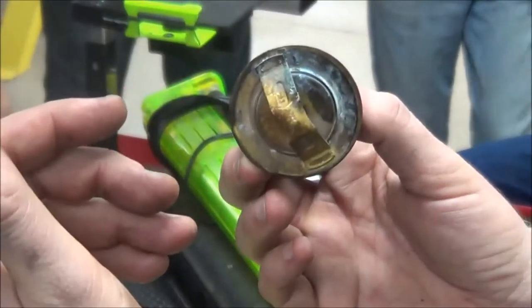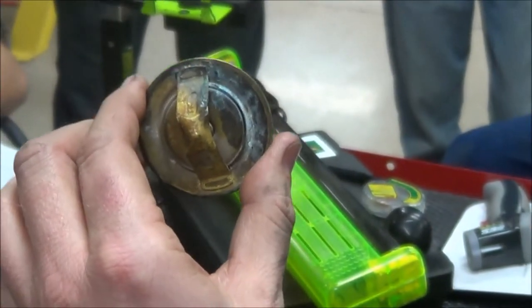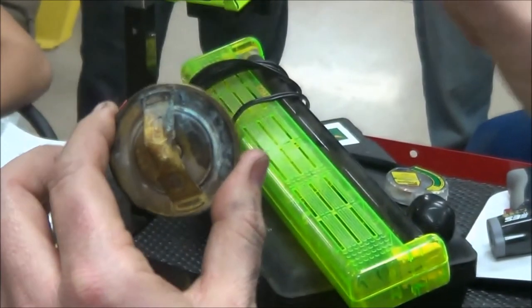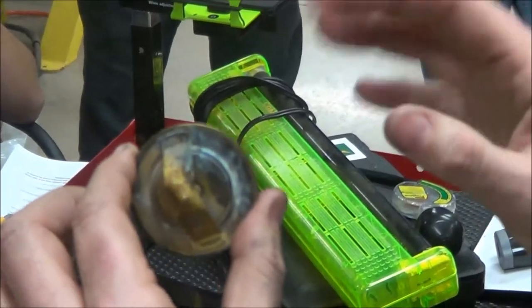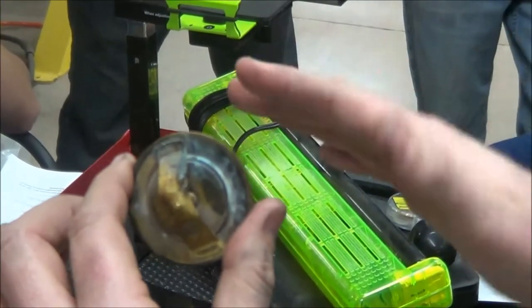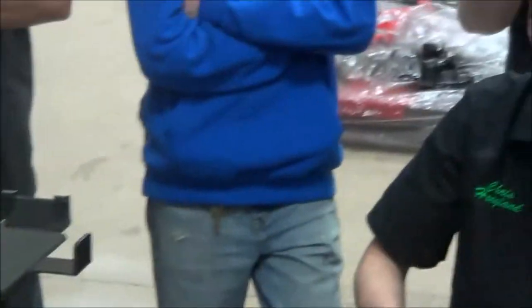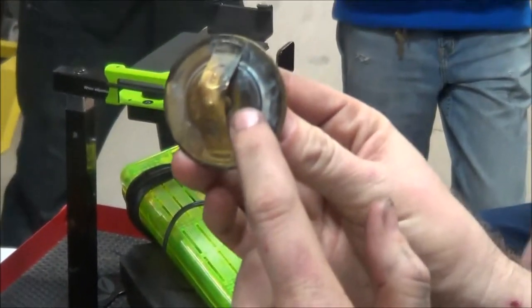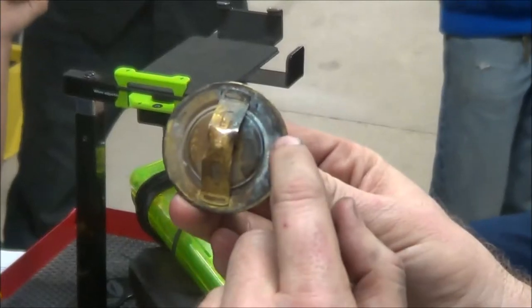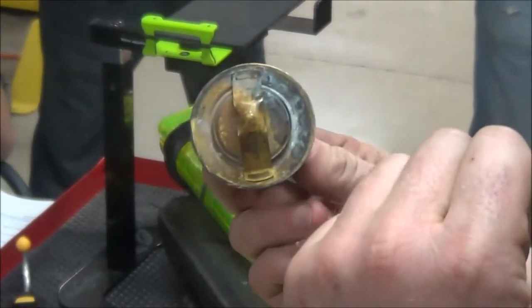Does that make sense? Once we hit that set temperature — you might see 220 to 230 degrees Fahrenheit, which is a common temperature in auto and motorcycles — that's a common reading you might see on your gauge when operating the vehicle. We can change where that engine runs by changing these thermostats. You can get thermostats rated for different temperatures that will open at a certain set temperature.